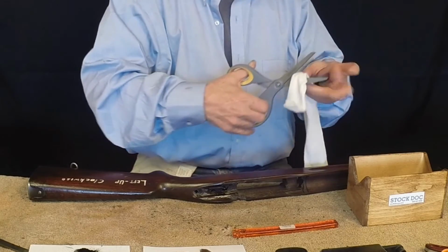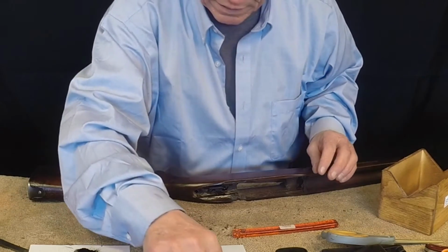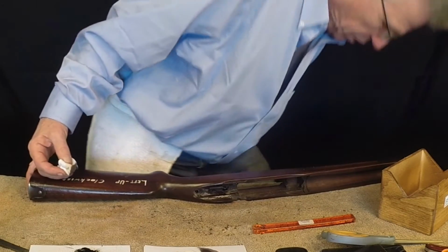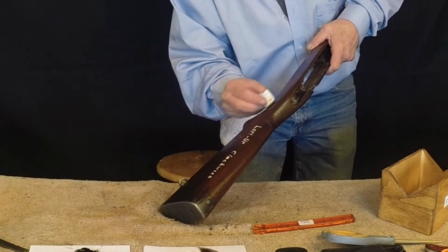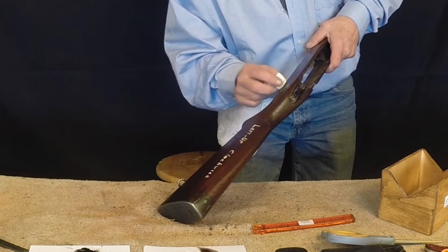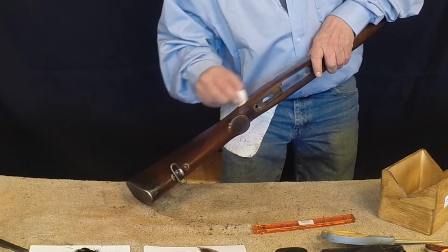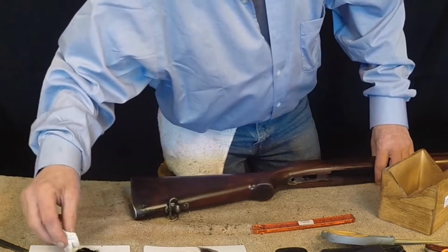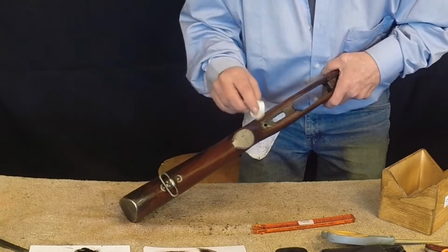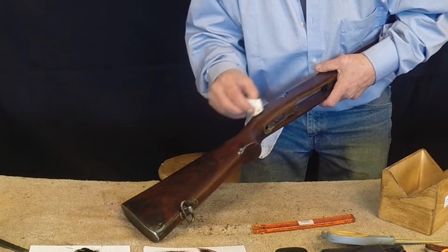We want to blend our existing finish to our new finish. So what we're going to do is we're going to actually blend it back to the middle and to the edges. Now there's going to be some spots sometimes where as you're running it, you're still going to see a little bit of your repair. So what you want to do is you want to just tap it on. It's going to lay it right on that section and then blend it out from there.